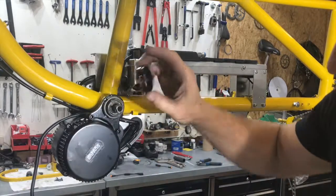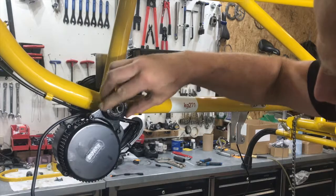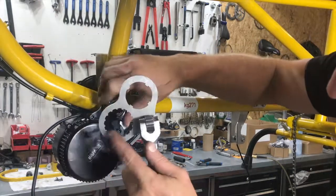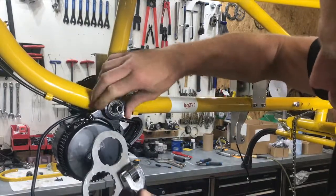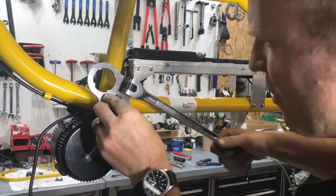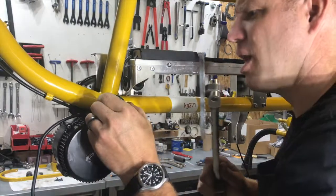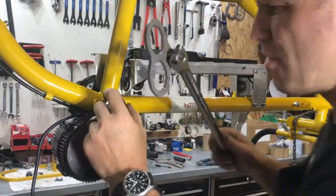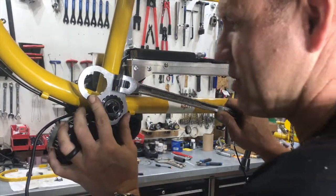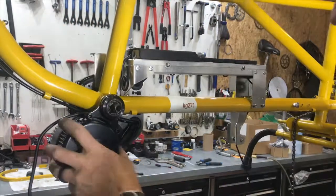Then I go on to the last retaining ring. It's a beauty ring, but it's also a retention ring on top of that other one — it's aluminum, so you want to really make sure that you're not cross-threading this as you put it on. That wrench comes on the other side of that one. Make sure that it's on completely square before you put any pressure down. This one is a lot less — about 30 Newton meters of torque. Don't want to over-torque this one; it would just strip out since it's aluminum, but still want it to lock up against that other ring.